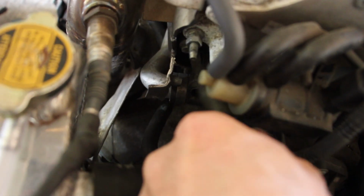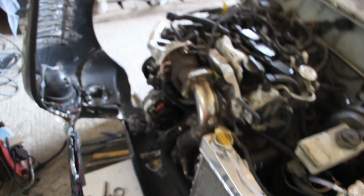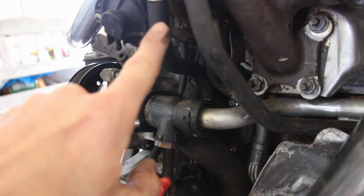We've got our expansion tank bottom hose connected up. Our hose here goes to the head and tees off to the turbo. And we've got a little clip coming, it's a special Ford fitting. We've actually ordered a new pipe. Breakers wanted more than a new pipe, so we've ordered a new pipe, cut the end off, and then that will get attached to there. And that joins up nicely. And then the overflow, if necessary, probably goes round to the back of the gearbox, so it's not all over the wheels. Lots of traction and all that. And then the block fitting, which is just in there, comes out to the turbo.